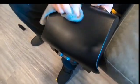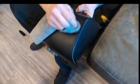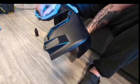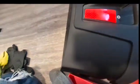This is because you do kind of have to hurry with a ceramic coating. You don't want to rush the process, but you only have a certain amount of time before it cures and hardens up. And if you mess it up, you gotta take it off and start the process over. So, trying to avoid that situation, I just decided to get my employee to coat the panels for me.